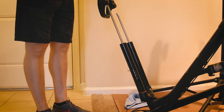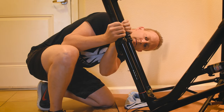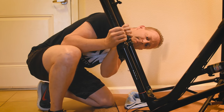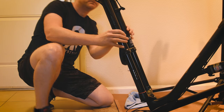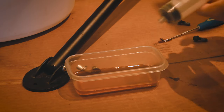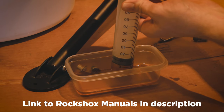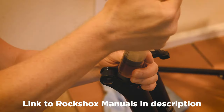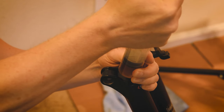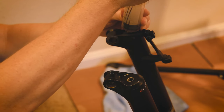I've turned the bike upside down so I can slide that lower unit back on. It's a little bit tricky here, but you'll get it — just don't damage those dust wipers. Make sure you leave some space between the shaft and those holes. Now my fork takes 10 milliliters on each side — make sure you check the specs on yours. Notice how I'm entering this at an angle so that I don't just shoot the oil into the shaft.